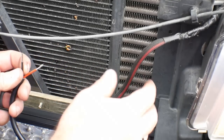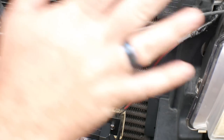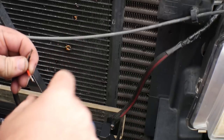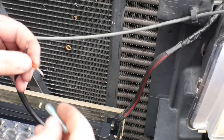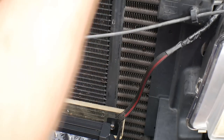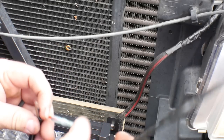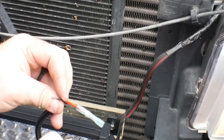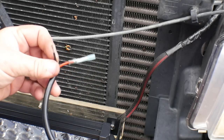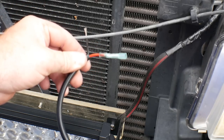Right here are the wires. When I purchased this truck it already had a light bar above the roof — that cab light bar is just a dumb idea, they make way too much noise. So I have a wiring harness already sitting here ready to go. When you put these connections together, one of the biggest pet peeves is people not using the correct things. You can either solder these or get a good set of weatherproof crimps. These butt connectors you can crimp together and they have heat shrink as well, which makes them weatherproof. I see so many guys using household twist ties and then wondering why their light bar failed after six months.